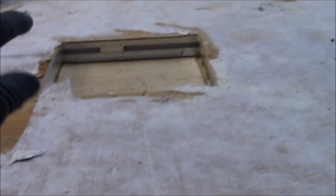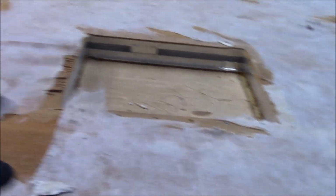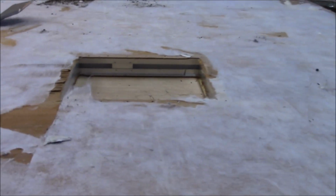And this is a really thin roof right here. It's not that thick. This is called ply foam. So up inside here is all foam. If you were to drill through here, we're going to go right into foam. That's all we're going to do. But they got the aluminum frame going around everything. So we're going to reskin this, and we'll glue down new decking as soon as we figure out our little repairs and everything we need. We'll scrape up whatever's flaking. That's all we really need to do. And then we'll skin over it, and we'll start getting a roof on this thing.